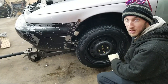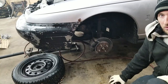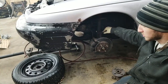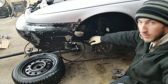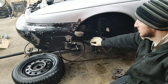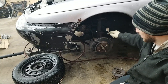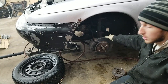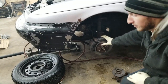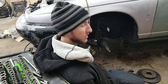We're just replacing the driver's side today, so we can get over to the brake lines on Midori that much quicker. Step one: remove the wheel. After you get the wheel off, get the strut bolts loose, remove the caliper and hang it somewhere — don't hang it by the flex hose, that puts stress on it and can cause it to fail. Then get the axle bolts off for access to the control arm bolt, and remove the tie rod end too.